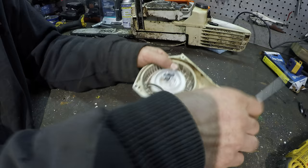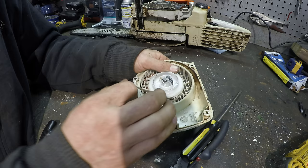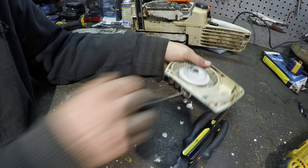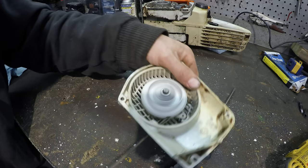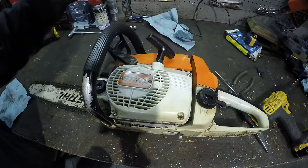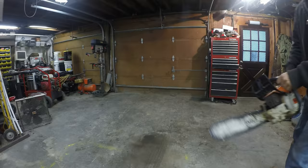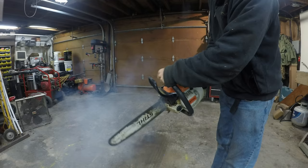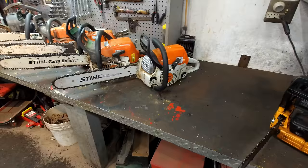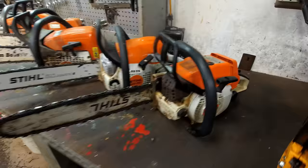One more. At least one more. All right, so that feels good. So now the rope actually stops and you can feel the spring isn't maxing out. All right, so that's working great now. Alright, well that was an easy job. That's nice, I didn't have to buy anything to do that.